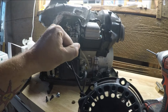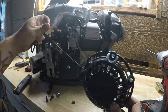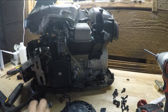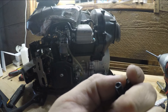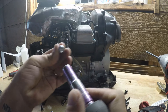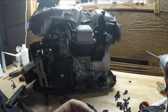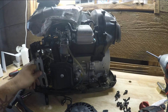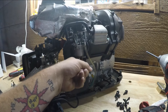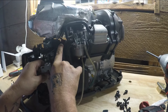The pull part — if you're looking at it from the front, not the muffler side — it's going to go on the left side on this one in particular, so it's going to pull upwards like this, and just goes in there like that. This one came with two silver bolts and three black bolts, but I'm not going to use them because they're 10 millimeter. I figured it's perfectly fine to use the original eight millimeter — five-sixteenths — ones. The bolt quality doesn't make a difference; it wasn't the bolts that broke, it was the plastic.